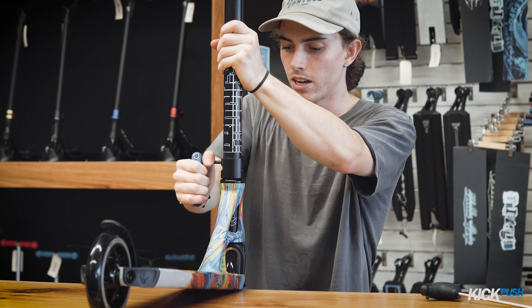With older scooters, you might need to tighten the clamp just a little bit more to make sure it's dialed and there's no rattle or wobble. We're going to do a drop test — I don't know for sure if it's super dialed yet, but that's the process. Do a couple of drops, and if you hear a rattle somewhere, try to isolate where it is and re-tighten it. I can hear maybe a slight rattle with the back, so I'm going to go over it again quickly. If it's hard to tighten, getting a parent to help or using small specific allen keys is a good idea. This one has a long end and a short one — the long end gives you a lot more leverage and it's easier to tighten.